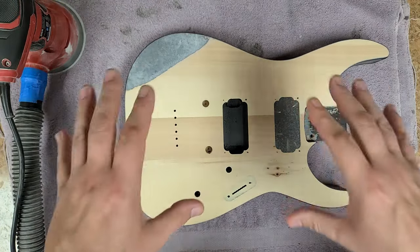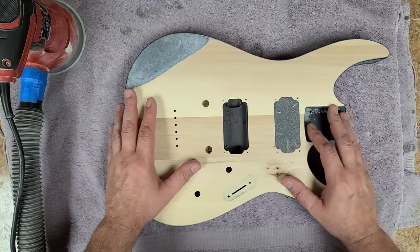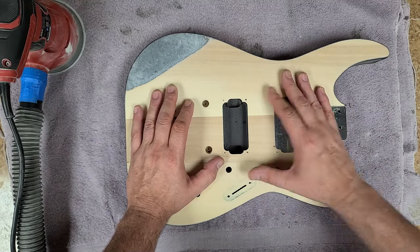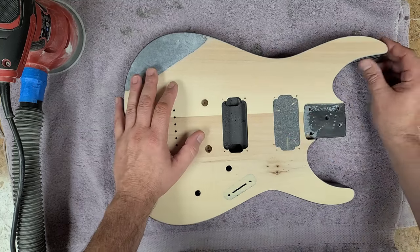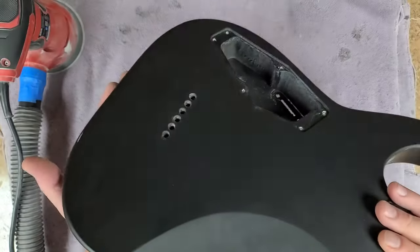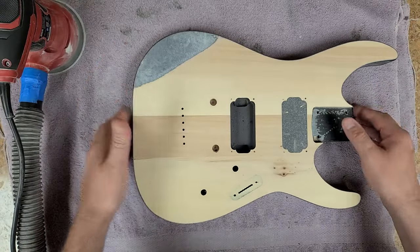In this case here, I'm not going to do the back of the body with epoxy resin, because the back of the body of this thing is in pretty nice shape. I can wet sand it with 800 grit or maybe 1500 grit and shoot it with some clear and actually clear coat the back of this without having any problems. This back is in like mint condition.